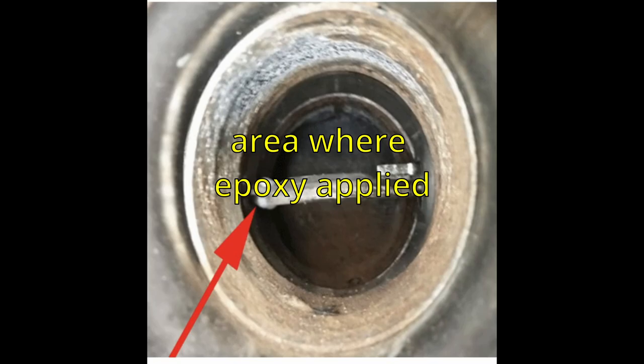Now that you've heard the rattle, you may wonder what is rattling. There's a couple different theories on this, and there's been a couple different fixes over the years recommended by both GM and online. One thought is there's a little pin in the flapper valve — the valve that controls different exhaust flow — which controls different sounds based on what goes through the muffler and what bypasses it. One early fix was to put epoxy on the ceramic pins on each side of the valve, which hold the valve to the rotating shaft. That fix didn't work well because those ceramic pins and the epoxy are right in the exhaust stream, and the hot exhaust eroded that epoxy, so the rattle would come back. This early fix was actually a service bulletin issued by GM, and a lot of owners took their vehicle into the dealership only to be disappointed months later when the epoxy wore off.